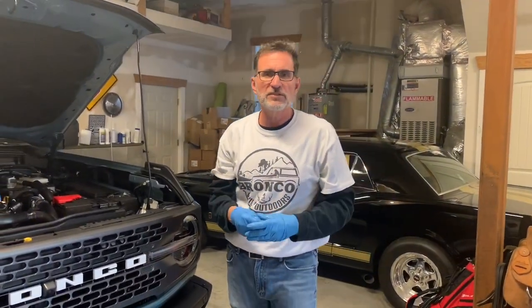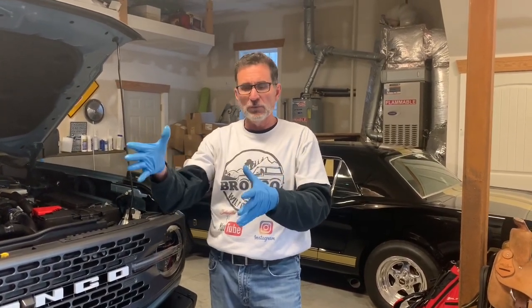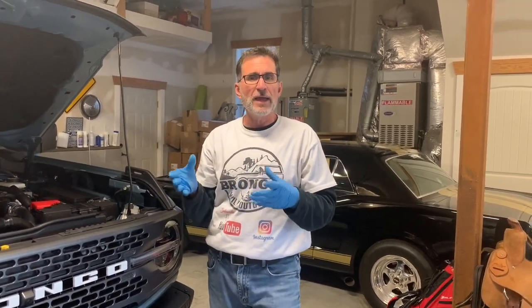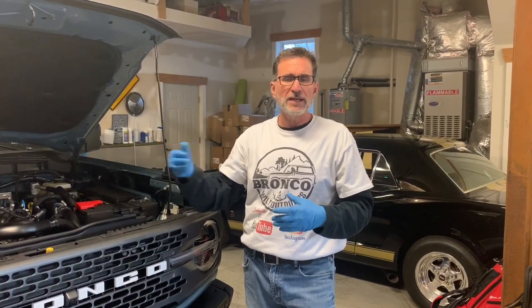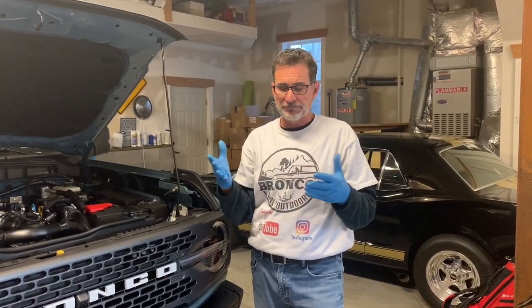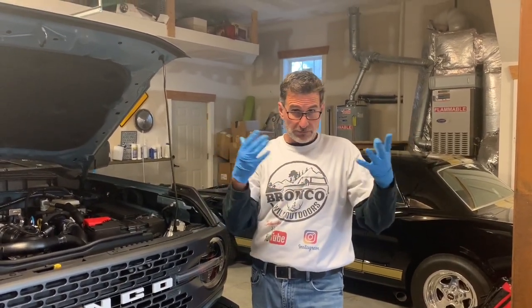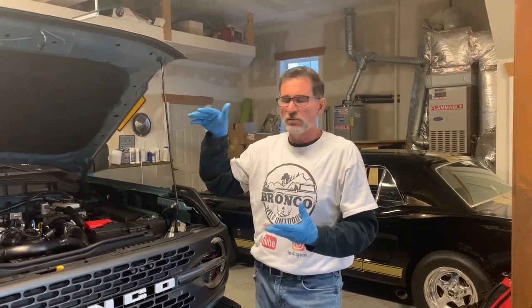Okay, so wrapping up this oil change video, this is a little more convoluted than you have to make an oil change. I do admit that, but hopefully you learned some stuff. The idea for me was to use several new containers so that we could move oil around and still sample it, but mainly to measure how much oil came out of this engine. We started with letting it sit for 2 days, using the crankcase heater this morning, letting it heat up about 4 hours. In 4 hours, the engine went from about 50 degrees, what it is in the garage, up to 124 degrees. And all of that was because of the 115 volt block heater that I had plugged in for roughly four and a half hours.